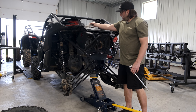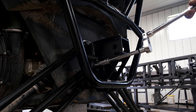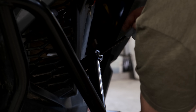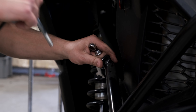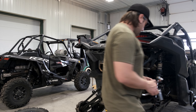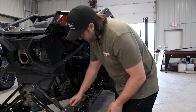One of the biggest reasons for upgrading your radius rods is not only for ground clearance and really sweet looks — they bend really easily, as you can see with this bottom radius rod. Our buddy Cletus stopped by and wrecked that in about 10 minutes. One of the reasons they fail is the bottom radius rod has a bend in it from the factory, and whenever you have a bend in a tube it's going to bend right there. Back tire hits, shoves in, bends the radius rod up — they're really not very strong from the factory.